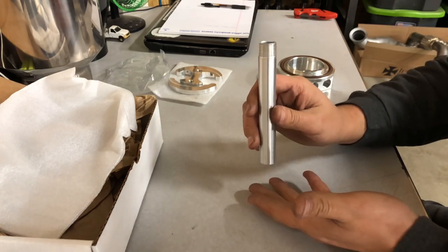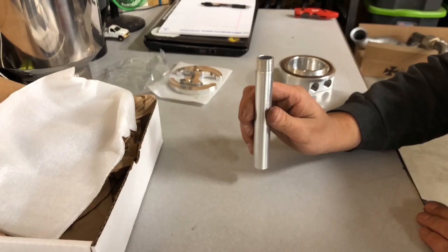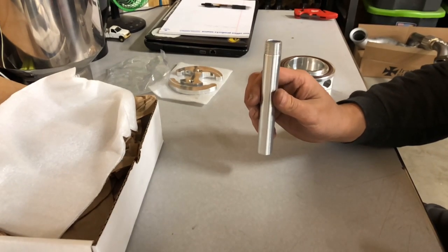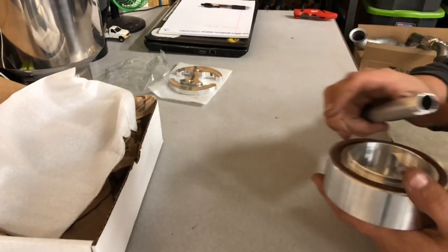When you add fuel, the bottom of the tank stretches back out, and now you might be an inch or so off the bottom of the tank. So when you're at a quarter tank of fuel, the truck is going to run out of fuel even though there's still fuel in the tank.